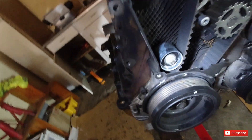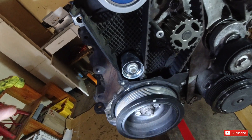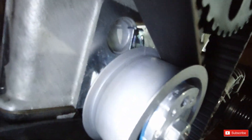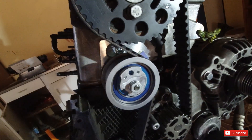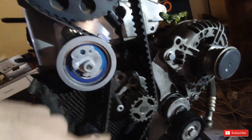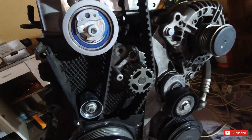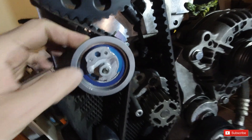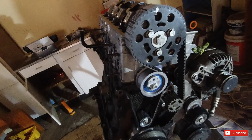The approach we took was to basically put the water pump back in and then the tensioner on. Just ensure - you'll see there's a small hole there where it aligns. It has to be out of that hole and there shouldn't be any tension on the tensioner. Then you put the belt on. It is quite difficult to get the belt on, but once it's on you can put the roller on and then do the tensioning.